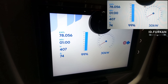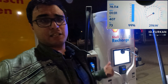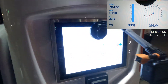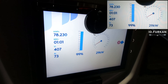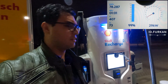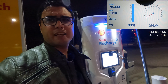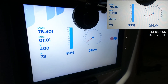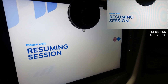The charger delivered 78 kWh including cooling of this car. The car is taking 125 kW but the charger is giving 129 to 128, and that goes with the curve. The battery didn't actually take 78 kWh, but it should be around 74 perhaps — there was some margin of error there. Now it's 100%, we are done.